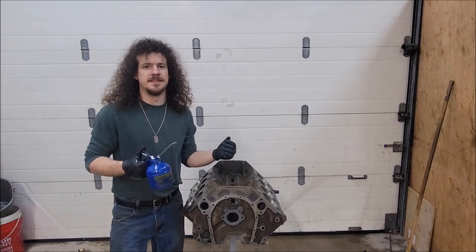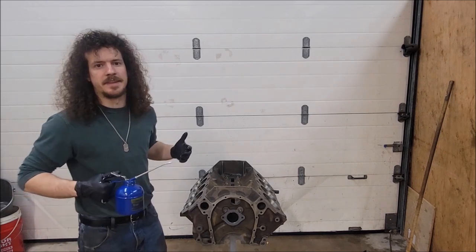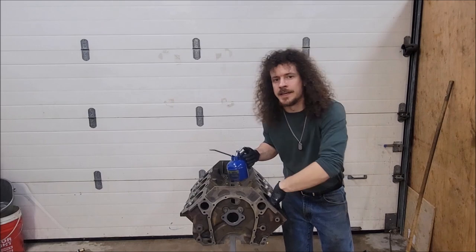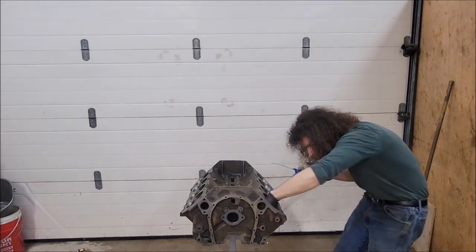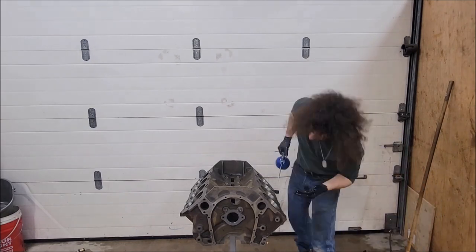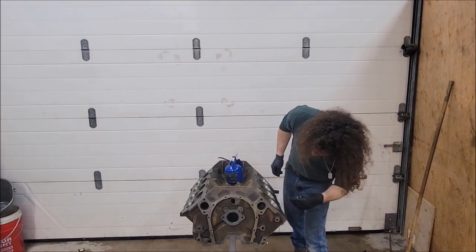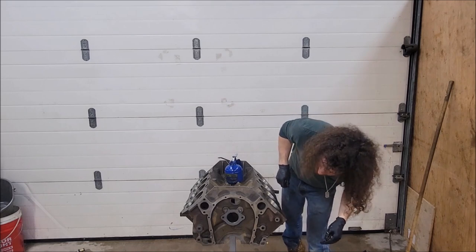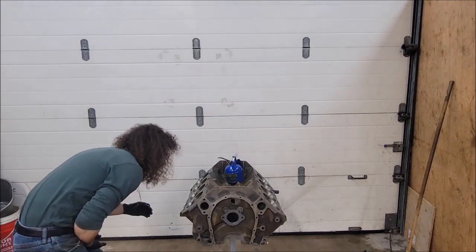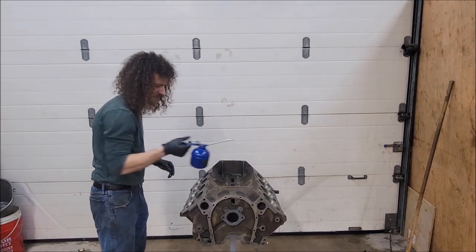Also, a word of caution — something that I see a lot but it's rarely ever mentioned: these cylinder walls are very sharp. I see a lot of guys oil the walls, which is good, but it's very easy to potentially cut yourself. So just keep that in mind once you're sticking your hand down in there. Just going to do one last look around and make sure everything is coated. You can kind of see the light reflect off the oil, and it's fairly obvious whether or not you've missed something — but it never hurts to double check. I'd say that's good.